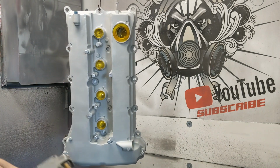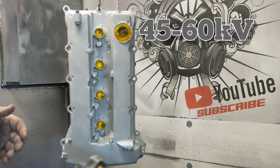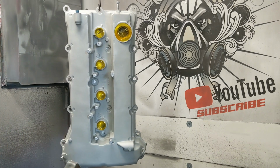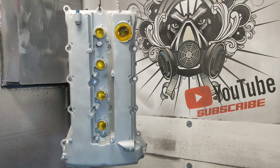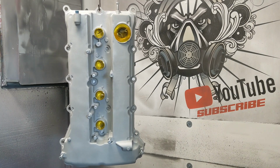Gonna be spraying Illusion Cherry. Directions recommend 45 to 60 kV. I have it set right about 50 right now, so we'll start throwing some powder at this thing and get her in the oven.